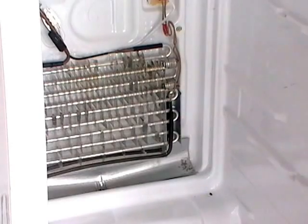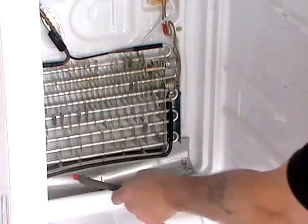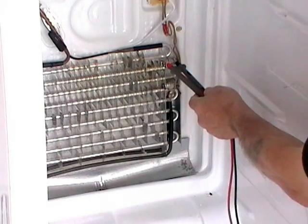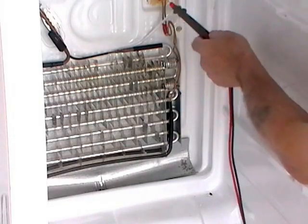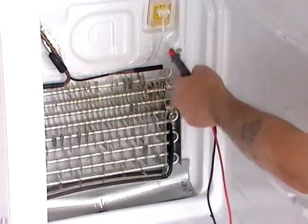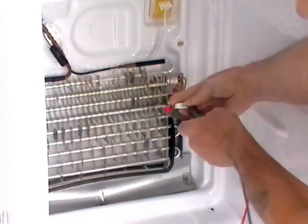On this RS-H1 we need to point out the defrost heater. It's an L-shaped heater with two thermal trips — one on each line of the heater, live and neutral. And it goes to a plug just in that little bank there. We're going to unplug it and do a continuity resistance check on the element to check that it's OK.